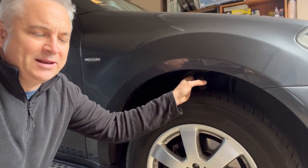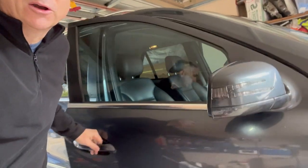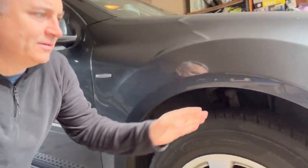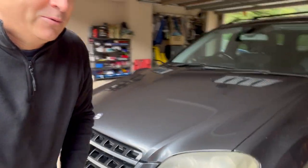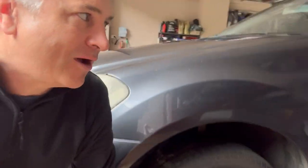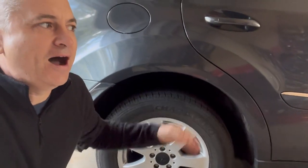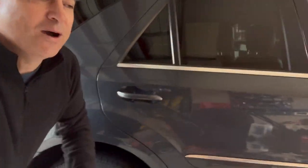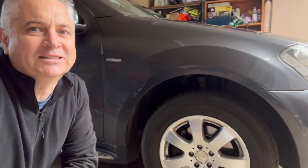I can fit the whole hand. I'll just open and close the front right door so it doesn't relock itself. We can fit the whole hand — let's take another tour. The vehicle sat overnight and we've got back to normal ride height on the front left. At the rear we've still got a good one and a half hands on both sides, but as you can see the vehicle has completely leveled up without even starting the compressor.